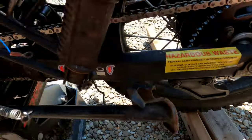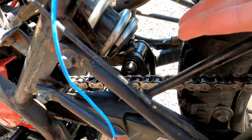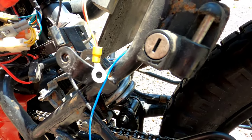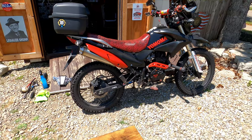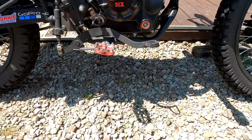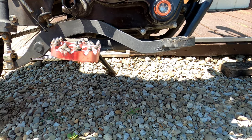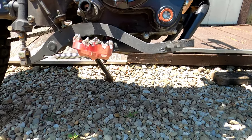It goes in sideways. If you don't have a 2x4, you could actually lower it down a little bit, but the 2x4 was the easiest way doing this all by myself with simple hand tools. You can see where those washers filled in that space. Now it's just a matter of tightening everything down top and bottom, then putting the seat and everything back on. So far I haven't done anything to the front end yet. I don't even know if I want to touch the front end — I kind of like the way it looks now. The only thing left to do is measure the distance from the ground up. Based on looking at the frame now, the bottom of the frame looks level, where before the back end was up at more of an angle.